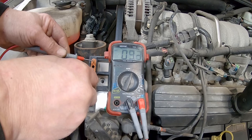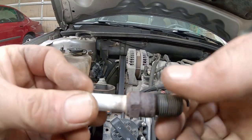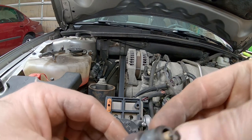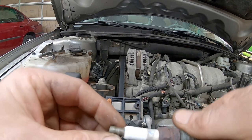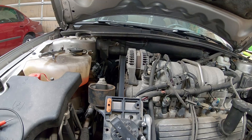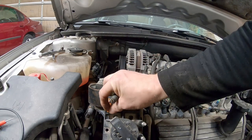We got 12 volts there — that's our ignition signal on that one — and we have 12 volts there. Here's the spark plug out of number 3, and it is old, probably original equipment. But I don't see any signs of damage. There's no arcing line up the porcelain. The plug wire itself is not in great shape. This is silliness — the misfire should have followed the coil. The fact that it didn't leads me to believe it's probably the ignition module.